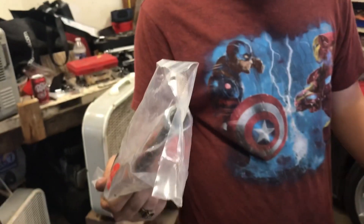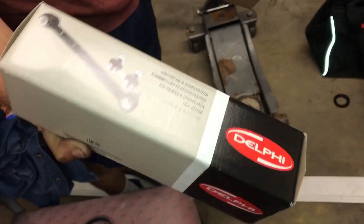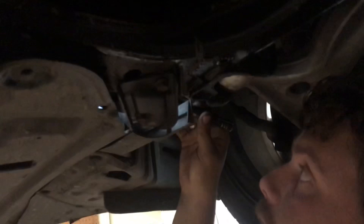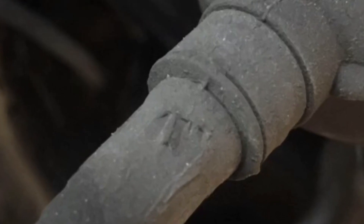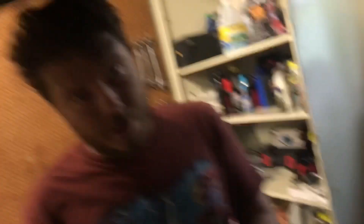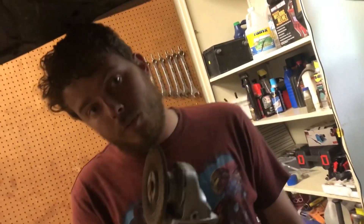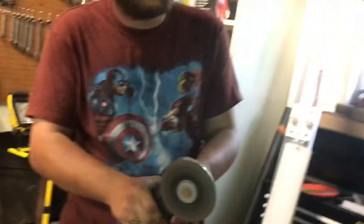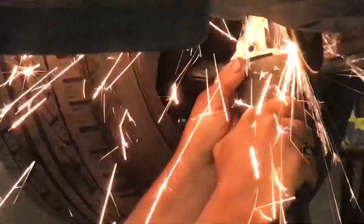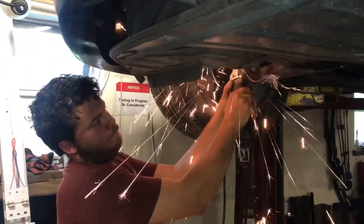And it is 135 degrees. This is the seized inner tie rod end. So the guy said that this inner tie rod end was seized. This is where Ricer Rescue really becomes Ricer Rescue. We already tried PB Blaster to break it loose. We tried using a little bit of heat, but we have a rubber boot there so we can't take the torch to it. So what we're going to do is grind two big slots on both sides of the tie rod, then see if we can stick a wrench on there and rotate it by hand. If all goes south, it's no big deal because we have a bunch of tie rods laying around so we can waste this thing and it won't be a problem.